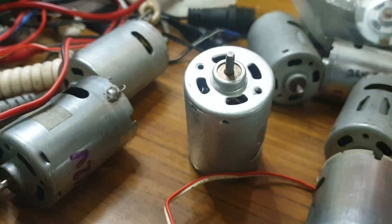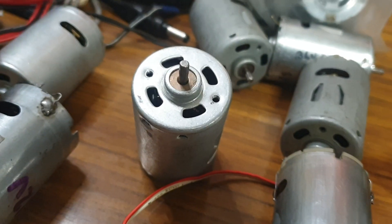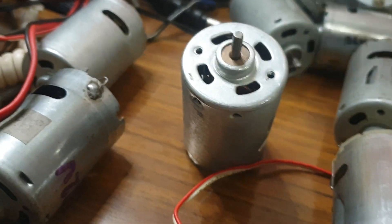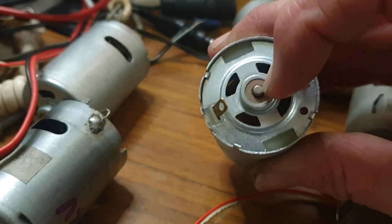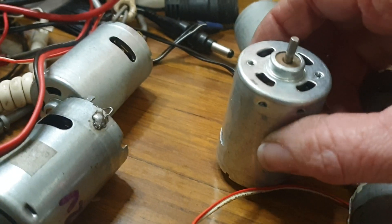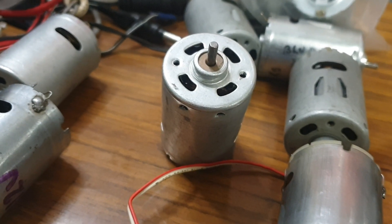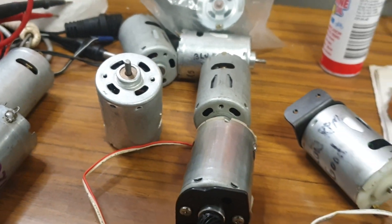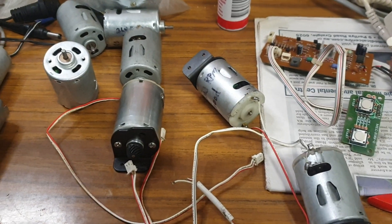The other thing I've done with these new garter carriage motors is I found they were making quite a squealing noise. I've just taken a little drop of oil, dropped it at the top, turned it over, and dropped a little bit on the opposite side. Then I ran the motor outside the garter carriage and very quickly the squealing went away and it's running quite nicely. I just thought I'd share my experiences — perhaps it'll help someone if you get stuck. Thanks.